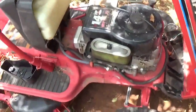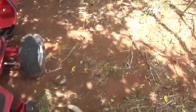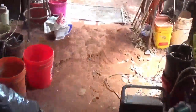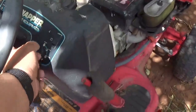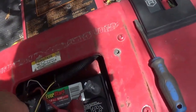So we either have a safety switch that's not engaged, or we've got our solenoid back here. Let me run in and grab a screwdriver or pair of pliers to jump across that solenoid. I'll grab a wrench and a screwdriver. Turn the key back into the on position. The way it's sitting under that cover, I'll try it with a wrench — and some sparks.